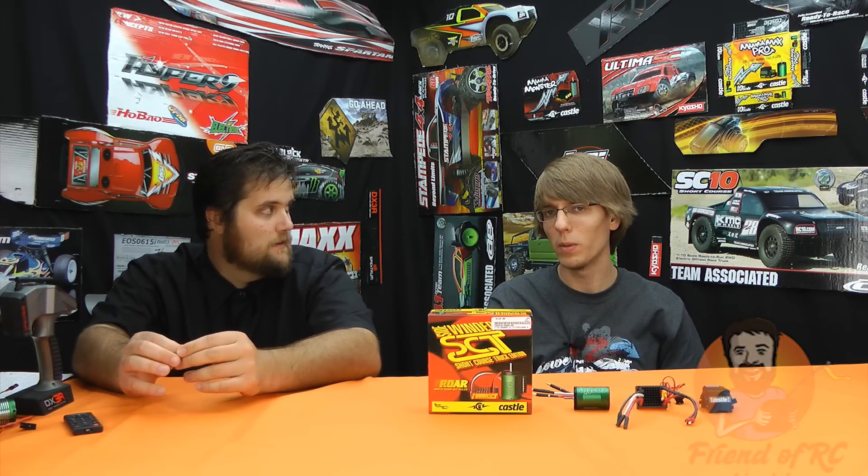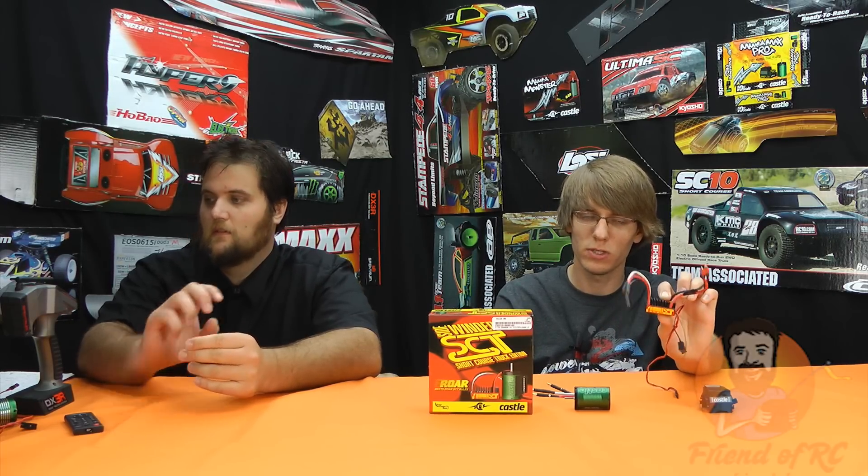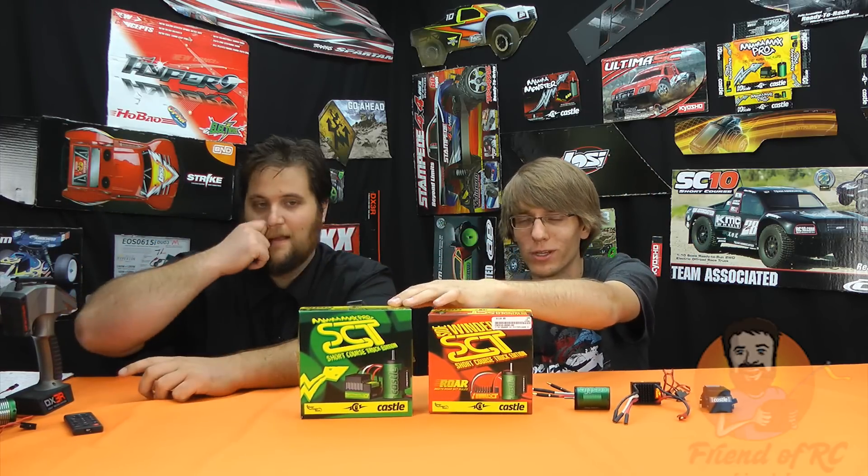There's an overwhelming amount of positives and a couple of negatives that come along really with the price point — hey, it's a hundred dollars, what do you want? If I could go back and buy it again, I probably would not — I would probably buy the V2. I would not go back and buy this again just because of the way I use my trucks. I would probably buy the V2 if it came down to a money issue, but if you've got the cash and can save up a little bit, get the new SCT Pro system instead of the Sidewinder — which, for all you noobs out there, the Sidewinder is basically a sport ESC, the lower end. The SCT Pro comes with a Mamba Max ESC. You can use it on everything you own, and it really translates really well. Keep an eye out for our review on that one.